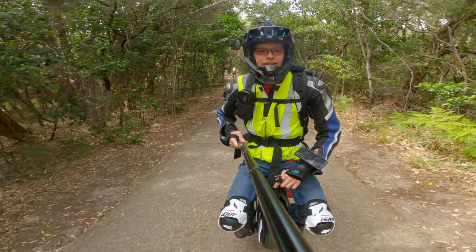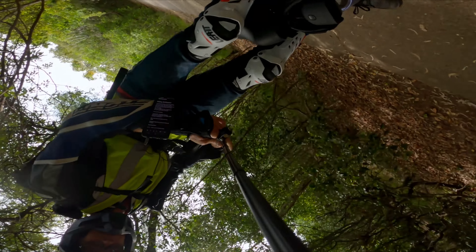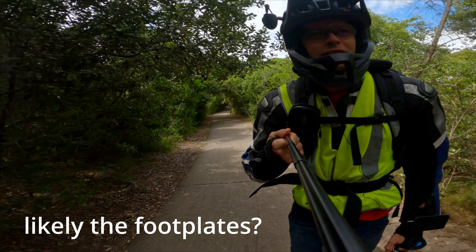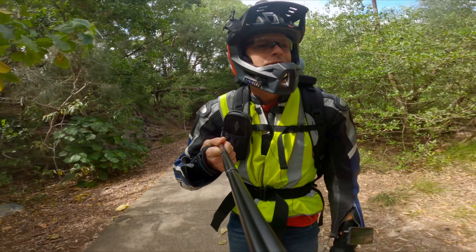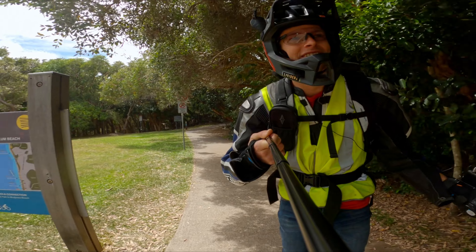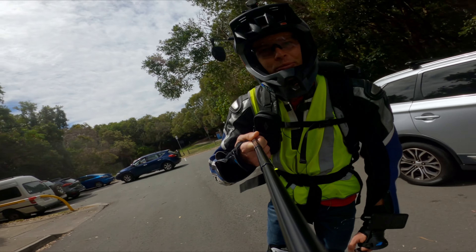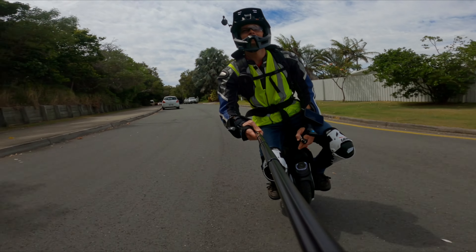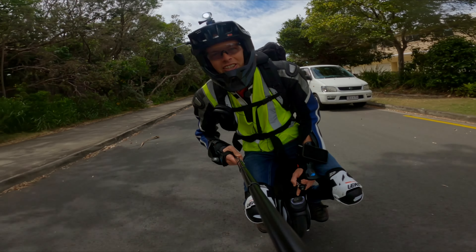What about the squeak and the suspension? I thought it was fixed at first riding around the patio, but it's still there. I did grease the suspension sliders — previously I also pulled the foot plates apart and lubricated that, but that didn't fix it either. I just don't know where that squeak is coming from. A bonus from this whole endeavour is that the wheel is easy to turn on now, which is great — in my review video I was having problems with how finicky it was, but now it's a breeze. Ride safe and I'll see you in the next one.